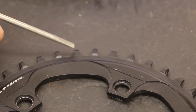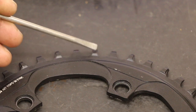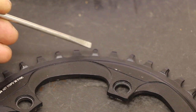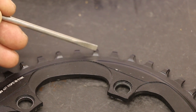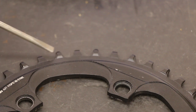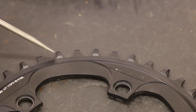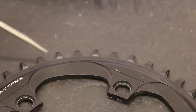And you can see on this one we got narrow — so that's our thin tooth. If we were to put a measurement on that, this would be thinner, and then the other is a little thicker — actually has a little notch, a little step down right there. So we got narrow, wide, narrow. The wide one's going to hold onto the chain, but then it jumps to the next one — the narrow, which is a skinnier one — is going to release the chain. So it's kind of a tight-loose-tight-loose grip all the way around. That works in conjunction with keeping your chain on, along with that clutch derailleur which is keeping the chain tight on this chain ring. They definitely complement each other.